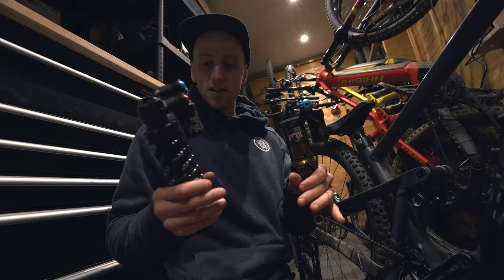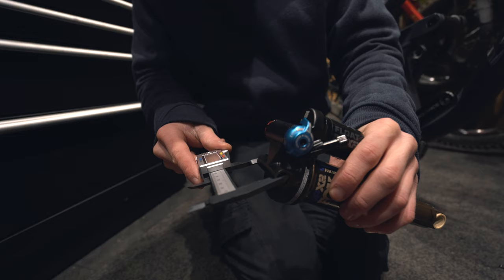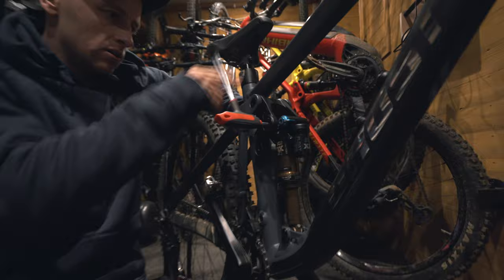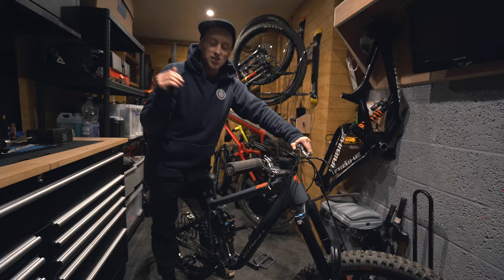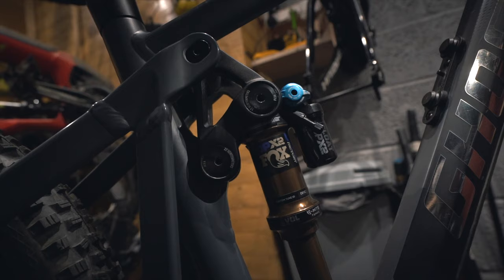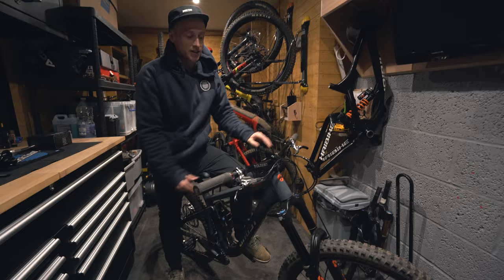Now they're both out, the air shock is a lot lighter than the coil spring — you can get titanium springs to save weight but that's my first observation. One thing I didn't actually do is check to measure that it's going to fit perfectly. There we have it — shock change done. It's a simple thing to do but suspension shocks aren't cheap. I've put 250 PSI in the rear and 150 in the front. It's literally like the bike's so stiff now, but you can adjust it — one click stiffer and it barely moves, or back off and still get a bit of suspension.